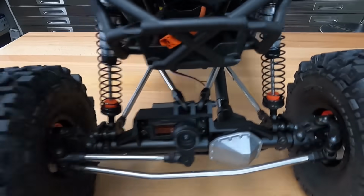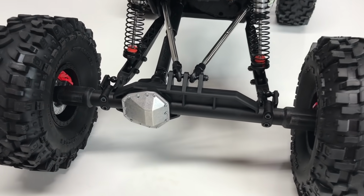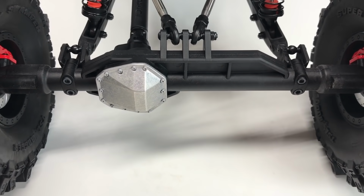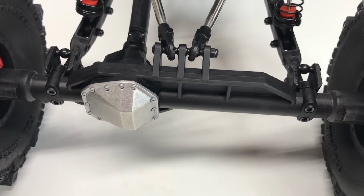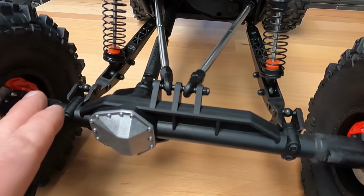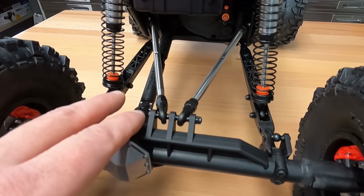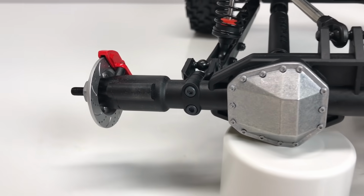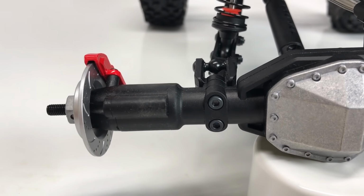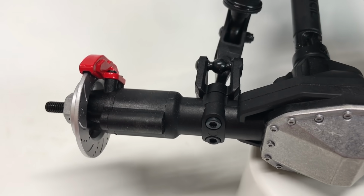All right, let me spin this thing around so you can check out the rear axle. There it is. Check out the truss work on the top of the axle. Everything is really built to hold up to the abuse this thing is going to go through. Inside, we do have ball bearings, rubber sealed throughout the driveline in most places. So internally in the transmission, there were some metal shielded bearings, and wherever they're exposed to dirt, that's where they have a rubber shield.